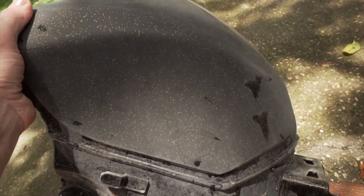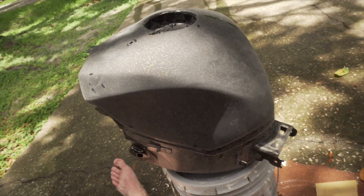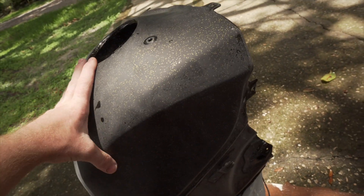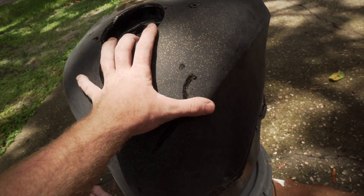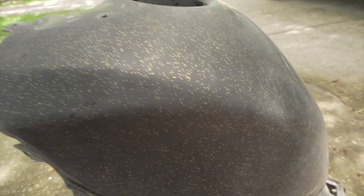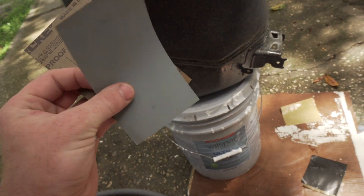Over here I got the runs out but I still think I have some air bubbles in a couple coats below, which is frustrating. I guess once it ran I should have stopped, let it harden, sanded it, and then made sure it didn't run before coating on top of the runs. Anyway I'm going to finish sanding — then do 1,000, 1,500, then 3,000 — and then hit it with some 3M rubbing compound and then scratch remover. So it's looking pretty good: I've sanded it with 800, 1,000, 1,500, and now I'm going to hit it with 2,500 and 3,000.